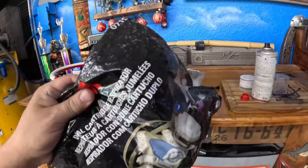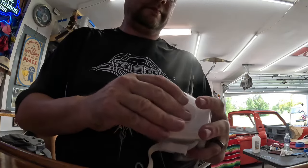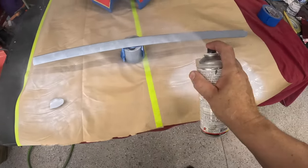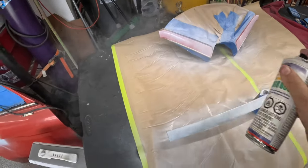All right, we took that button, we popped the activator in the bottom open, released it into the paint. This is not your typical hardware store spray paint. It's some potent stuff. You're gonna want a respirator. Gave that a quick tack coat, we're gonna let that sit for a while. And that gives the next heavy coat something to stick to.